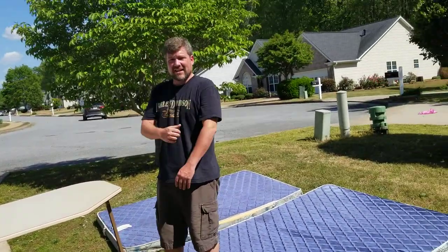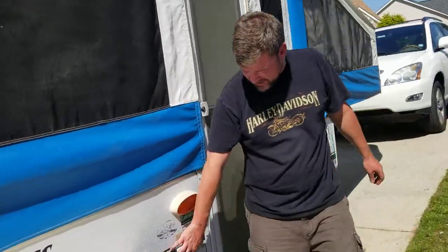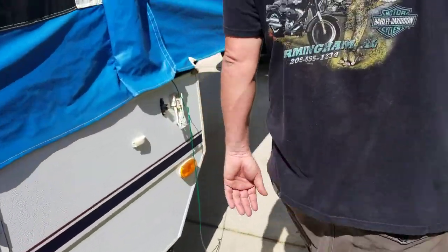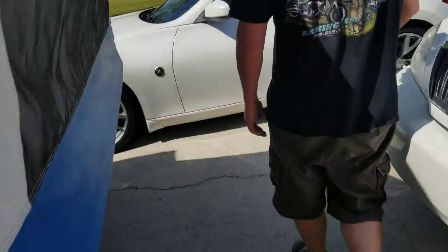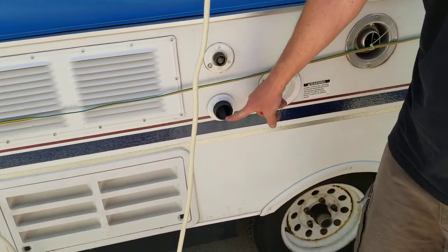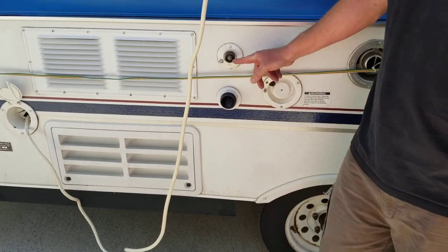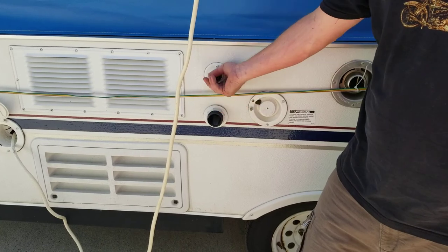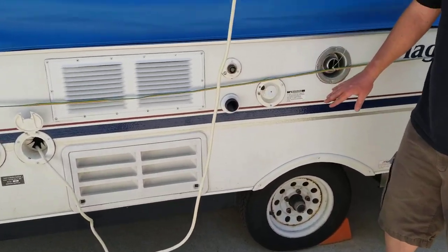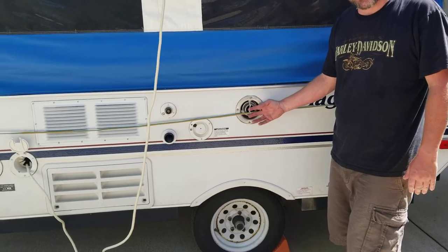A couple other things to consider on the outside of the camper. Walking around the other side, you have an outdoor outlet and a nice light that comes on and off. On the opposite side, if you're camping somewhere with electrical hookup, that's available. This is your drain tube for the sink — you can have a hose for this, or normally just let it drip right out of the side. This is also your water intake — there's a hose on the inside of the camper you can plug in directly, turn that on, and then you have water to your sink as well. There's also a place you could fill up water without a hookup, and an exhaust vent for cold nights if you're using the heater inside.